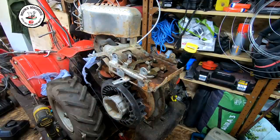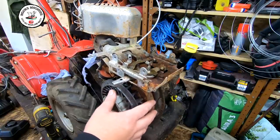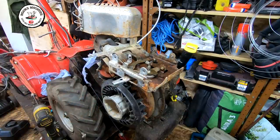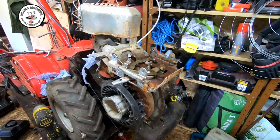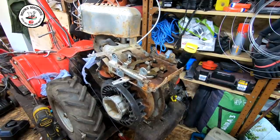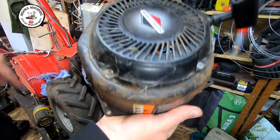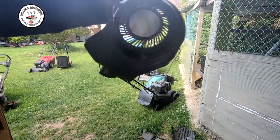I've given it a blow off — it's now just soaking with some degreaser on it, just to try and help it along. I'll give the old flywheel a bit of a sand to help with the air gap. I could remove the coil just to get a bit of the gap back, but the machine has fired with some spray down the top of it, so we'll go from there. I'm going to spray the pull cord cover up now — I'll get it masked up, just going to put some masking tape over the stickers to protect them, and then just spray this up nice and black.